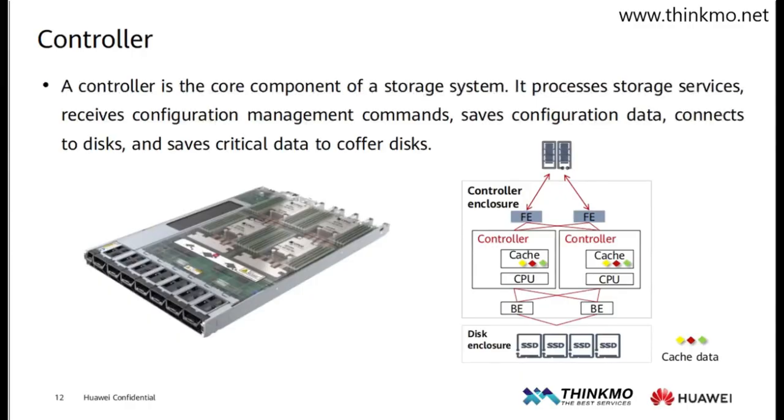This part, the cache, if, for instance, there is a power outage, as we mentioned earlier, we have a backup battery that we can use directly. The backup battery ensures the persistence of our data, meaning that after a power outage, the backup battery will maintain the normal operation of our server, and then we can take the cached data and directly transfer it all into our hard drive. The use of a battery is actually very important in our system, within the overall structure, right?